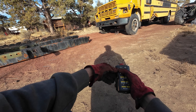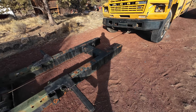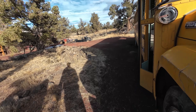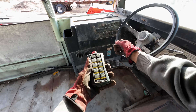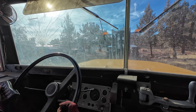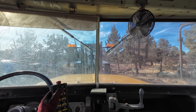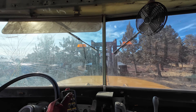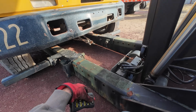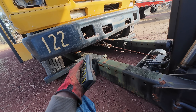Now let's winch this thing in and make sure those masts are going to clear and it's going to be straight. One thing about the True Hitch - being straight is one of the most important things. I've got this sight right here on the mast. We want to get it straight - which we are not quite yet. There we go. We're up against our stops now. See how much more we could have come forward and reduced our overhang here? I could have brought those tire stops way up. If I were actually towing this down the road I would have done that, but since we're just demonstrating we'll leave it here.